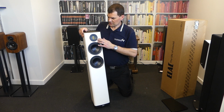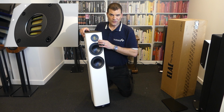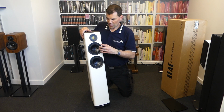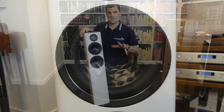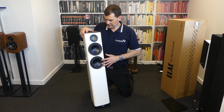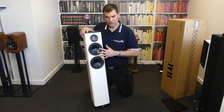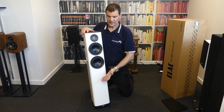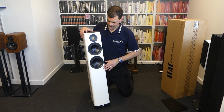There's the Jet 5 tweeter along with a dispersement ring around it. Again, they've reserved their best technology for the speaker range. The now iconic triangular pressing of the mid-range and bass driver. Again, this is a 2.5 way design with approximately 150mm mid-range and bass driver. The bass is reinforcing in that crossover network to ensure that essentially it's a bookshelf speaker with a bass driver to continue the low frequency response down an octave or two.